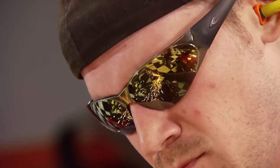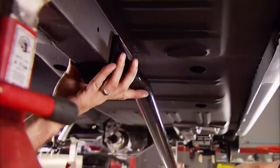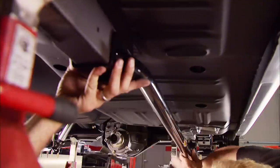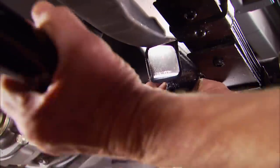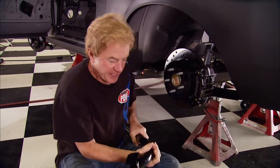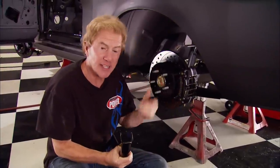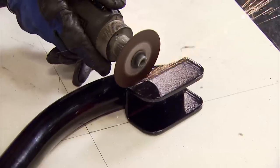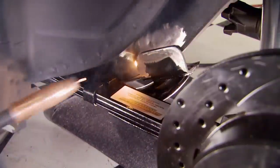While he's making lots of annoying noise, we're going to install our Global West subframe connector. You've got to have these in a track car to prevent torsional twist on the corners — they attach to the front and back unibody frame rails. With replacement shells you've got to expect a few fitment issues, and we can't modify the connector, so we'll see what we can do with the subframe. When in doubt, cut it out — we're just going to tack weld the connectors in place for now.